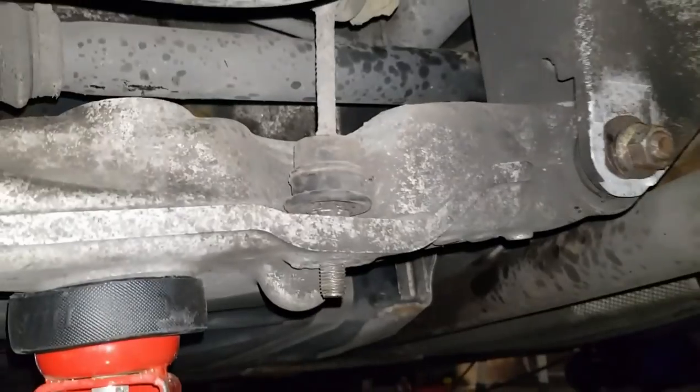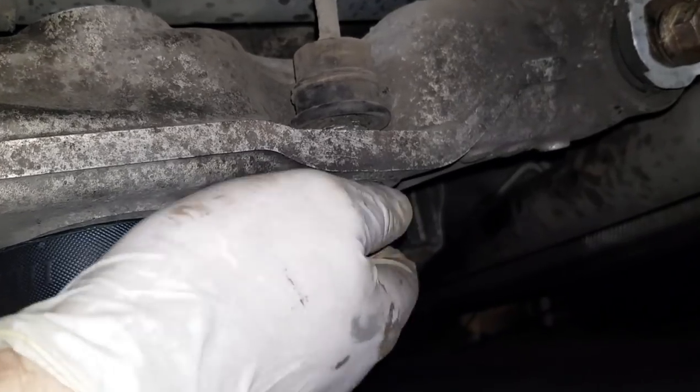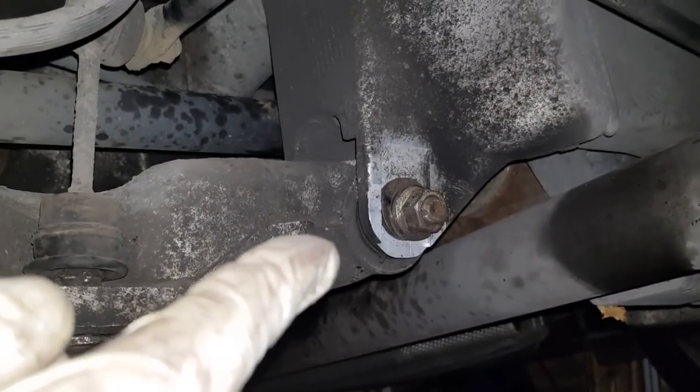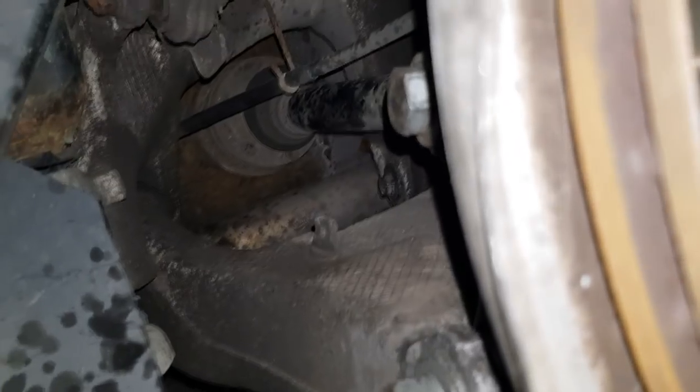So I've got the wheel jacked up to right height, with the bolt secured back down through that hole. Okay, now I'm going to have to hold it in there with my Torx 40 while I tighten this. I'll tighten the eccentric wheel alignment nut to torque. Tighten this, and these two to torque specs. I'll go and find that now.